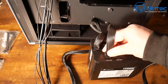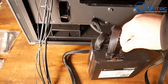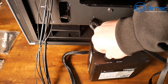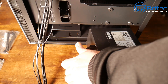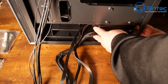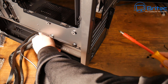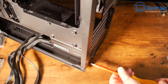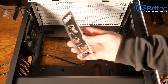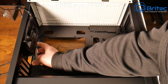Now we can put in the power supply. The good thing about these semi-modular power supplies is they cut down on cable management, and this PC doesn't need anything complex since it has no GPU — but I'll put a GPU cable in anyway, just in case whoever has this PC wants to add one later. Let's put the four screws in, and that's done. Now we can fit the IO shield on the back — it just pops and clicks into place.